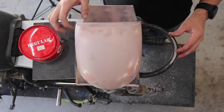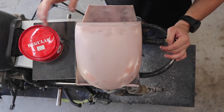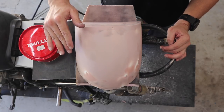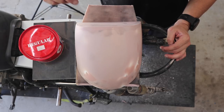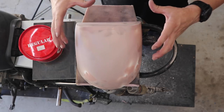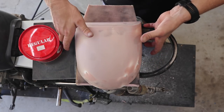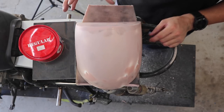With a new plug like this, you want to do about 6 layers. The reason you need to do so many layers of the wax is because it's a brand new mold, and all of the little pores and holes need to be filled up with this stuff as much as you possibly can, so that once you do your actual mold over the top of this plug, you can release it and it comes off easily without having any dramas with it getting stuck.